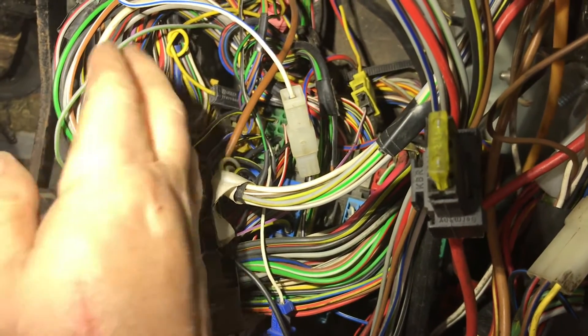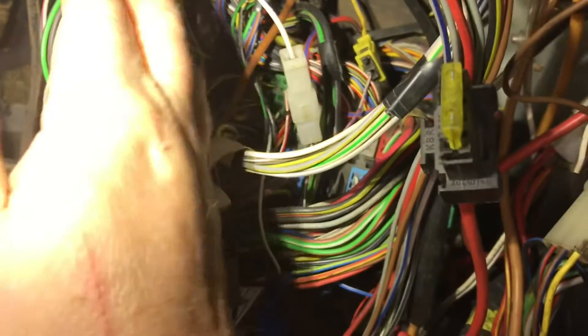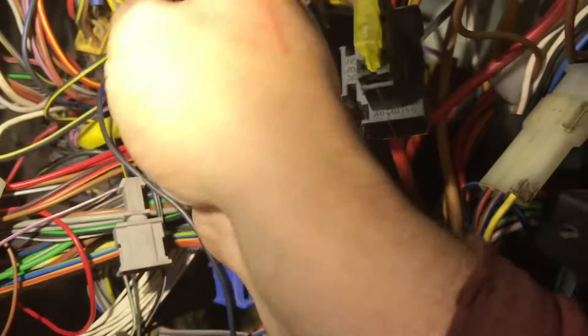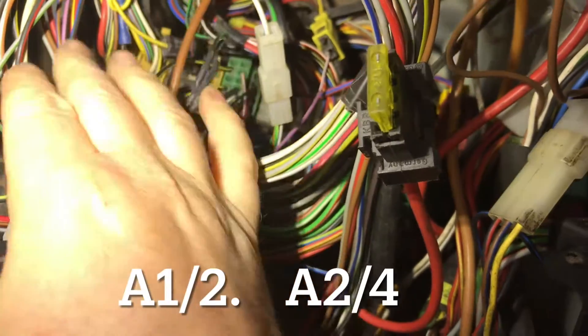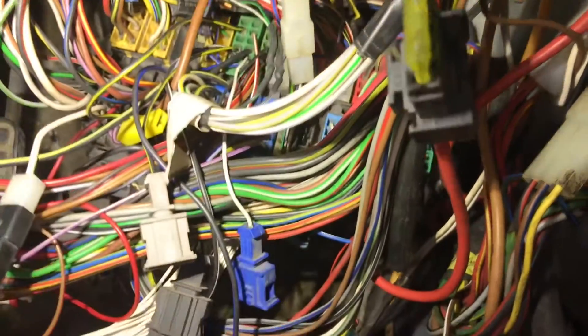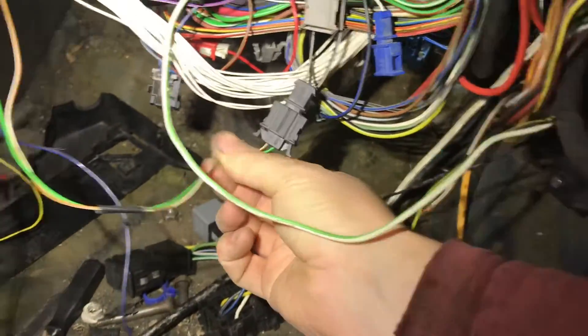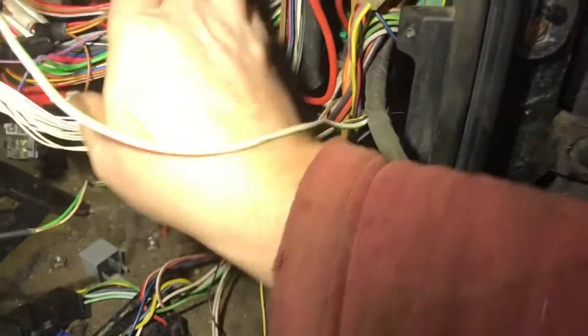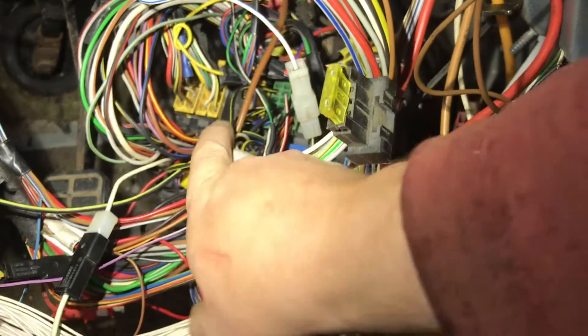On the later cars the dash would actually tell you left or right. These two wires here — I've already soldered onto them — you have to tee into them and bring it down to the plug. This plug goes all the way up to your dash and is connected to these two light-blue plugs which are U1 and U2. So we've done A1 and A2.